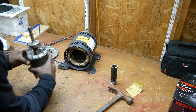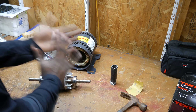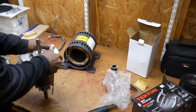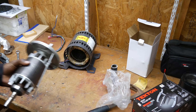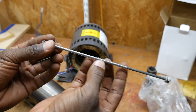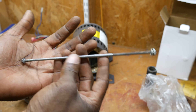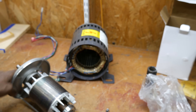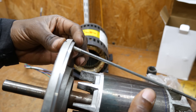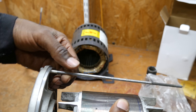Is that fully seated? I've got just a tiny bit more to go. Both bearings are pressed on and it's a really snug fit. Now let's slip it back on. One thing to point out: these long bolts have a plastic sleeve on them — that's electrical insulation making sure no wires can short out against the bolt. When I initially tried to get this end off, the sleeve started curling up underneath the bolt, so that's why I left the bolt in there rather than tear off the plastic insulation.